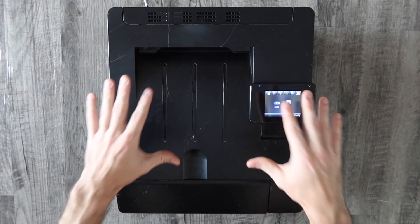The second method is picking your SSID and manually typing in the password on the screen. As you can see in the top left we have an LED Wi-Fi indicator meaning we are not connected to a wireless network — it's pulsating, but after we connect it should become a solid blue light. Tap on the Wi-Fi icon on the menu, go to wireless menu, then go to Wireless Setup Wizard. Now it's looking for SSIDs that are in range. Ours is 'eight foot ceilings'; if yours doesn't come up, scroll up and down to look for your network.